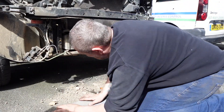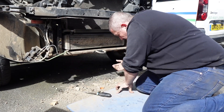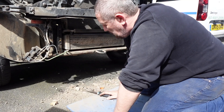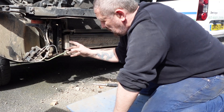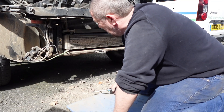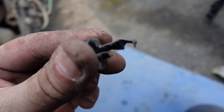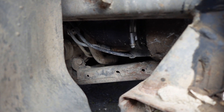You can't quite see from this angle but there are a couple of shields either side of the sump tray that give me access to the intercooler hoses. I've had access to those before when we changed the hose when we first got the vehicle - they're just clipped in with some trim clips. We can get those off and should be able to get to the hose clamp and undo the intercooler hose. The clips are looking pretty ropey so I'm going to fit a whole new complement of clips when we put everything back on. There's the shroud from the driver's side and there is our intercooler - we just need to loosen that off.